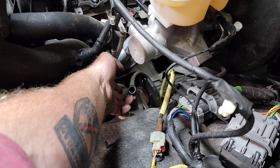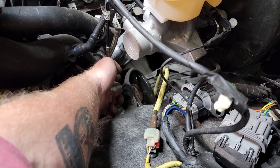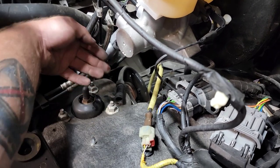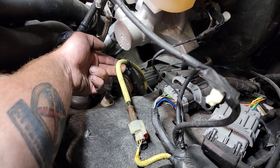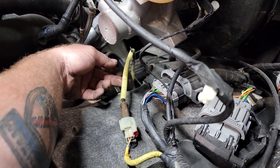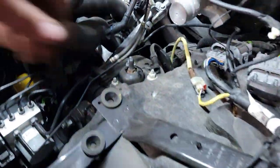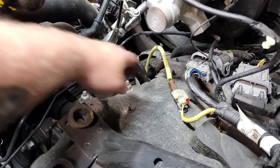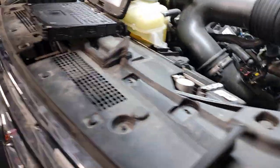There must be a vent for the four-wheel drive system — yeah, it's for that new four-wheel drive system. This is the wire that goes down there and feeds the IWE — the electronic vacuum control, the newer system. Could be wheel speed sensor or IWE. Anyway, back to what we were doing.